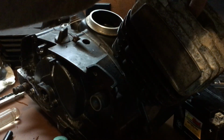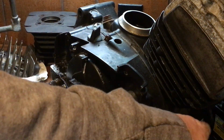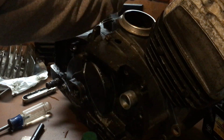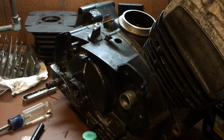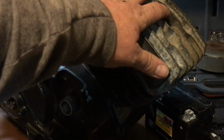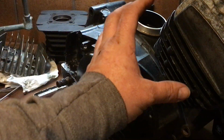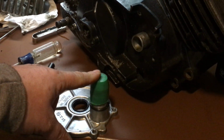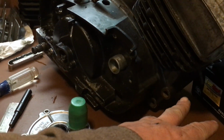Now, when I'm putting air into here, into the spark plug hole, I'm not getting air out the intake or out the exhaust. It's a sealed unit now. Okay? The crankshaft is all the way down at bottom, top, dead center. So, after that, I have about 2 pounds of air going into the cylinder, which is charging the whole crankcase, not the transmission section, just the crankcase. Alright, I'm blocked off on the intake, so I'm not going to lose anything out the rotary valve. I got the exhaust blocked off, so I got nothing coming out the exhaust.